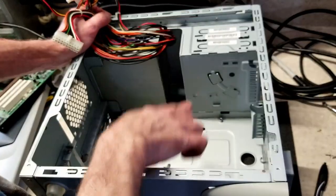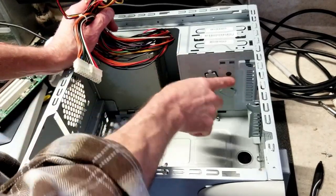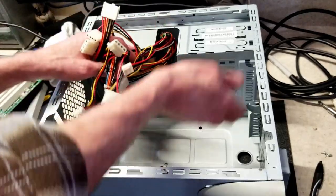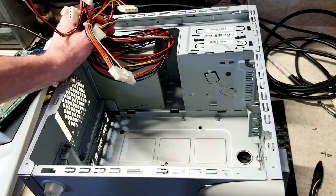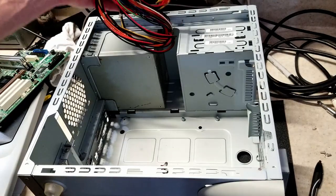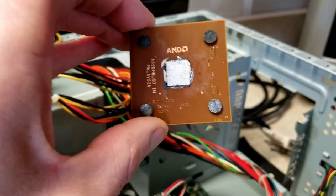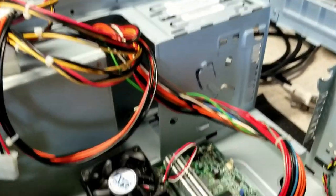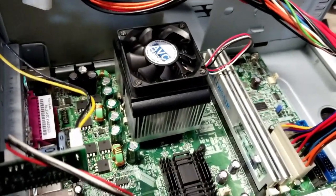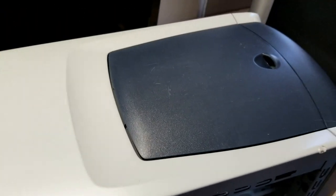That was quite a chore — a lot of cussing and swearing just to get the power supply in there, but I didn't have to pull the motherboard. I tucked the wires into the 5.25-inch drive bay and tilted the power supply to slide it in. I probably should have done this before putting the motherboard in — that would have made it a hell of a lot easier. Quick test reveals the Athlon XP 2000+ chip appears to be dead, so I put the 1800+ back in and it booted right up.